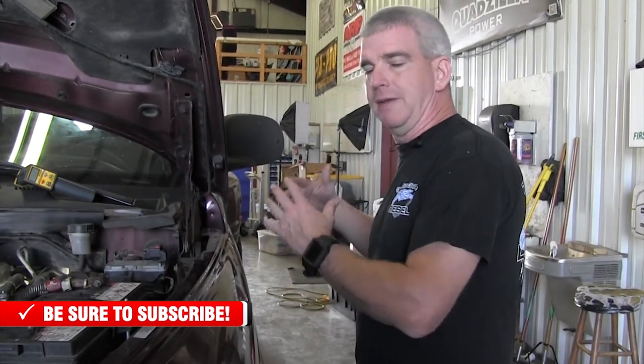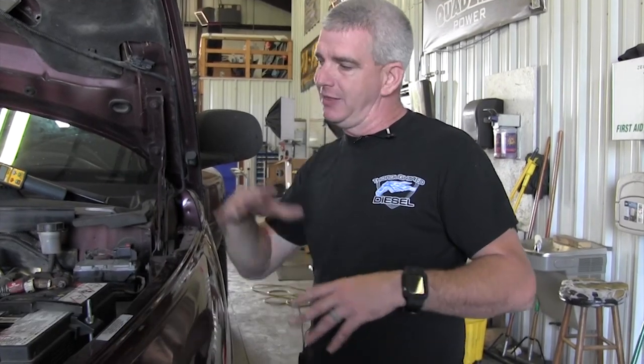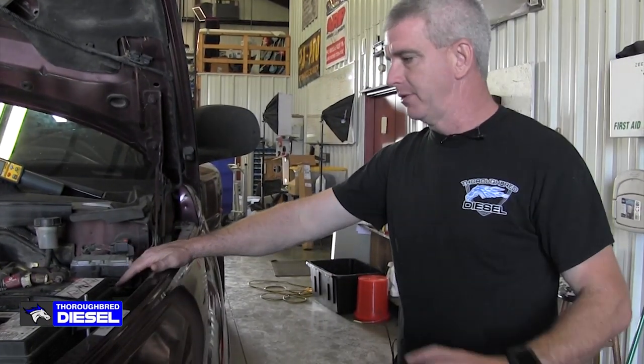They had a lot of advantages there, but that pump will fail. So you had failures of something that was now inside the tank, and it was a lot harder to change — you had to drop the tank to get to the lift pump. That's where the in-tank lift pump came in on these models: the second gen and the early third gen models.